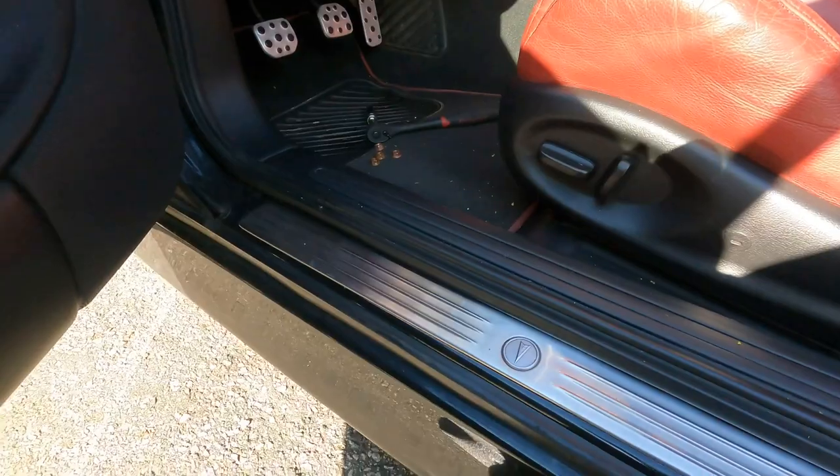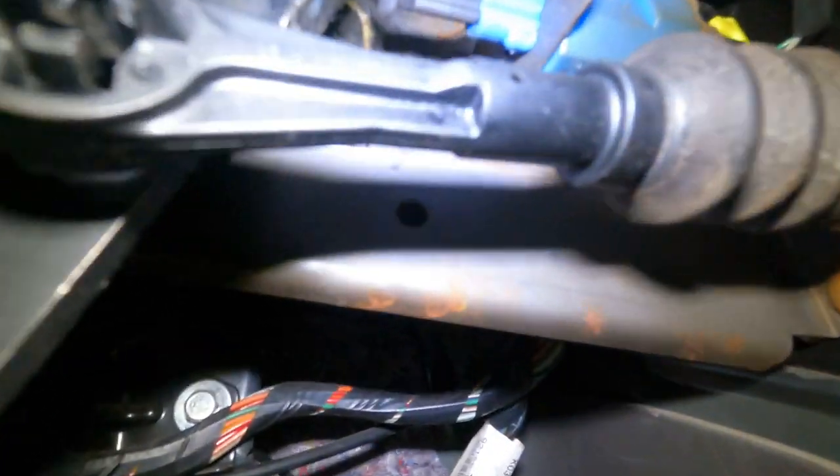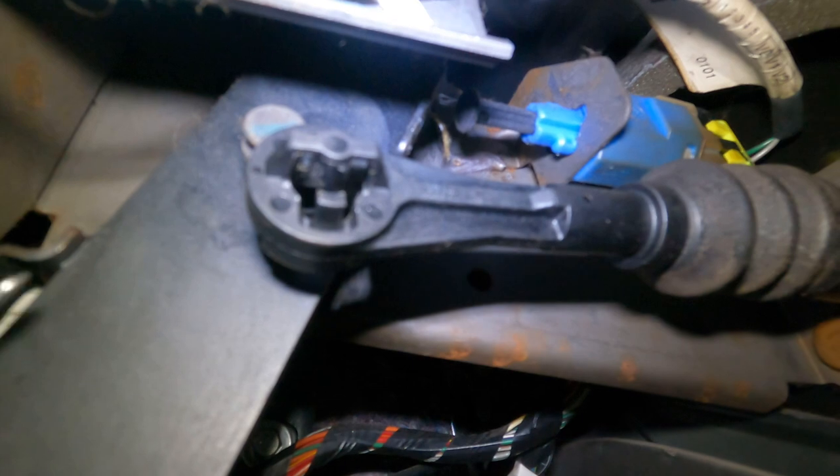Something to keep in mind: before I took the car apart, I did not move the seats back, so I had no room to get in there - I squeezed myself in. I disconnected the clutch master cylinder from the pedal. As you can see, we got this little nub and this little plastic piece. What I did was - there's a little groove - I put a screwdriver under there and wedged my way in and used a tiny little pick to get that little plastic tab down while prying, and it popped off. So this is all disconnected down here and we can get into a good working spot in the engine bay.